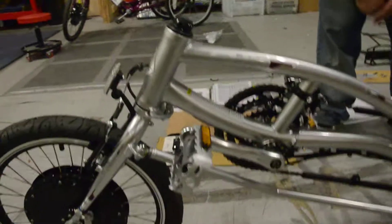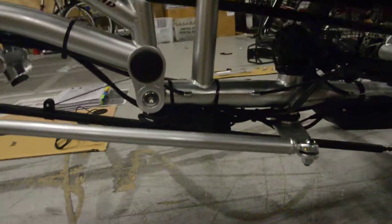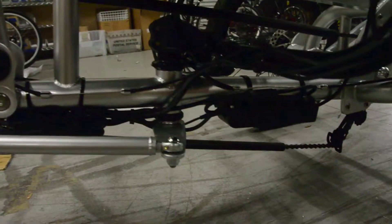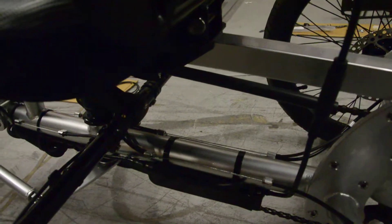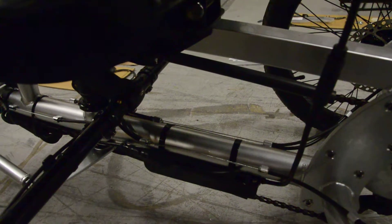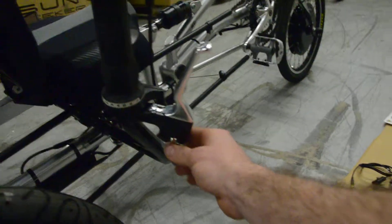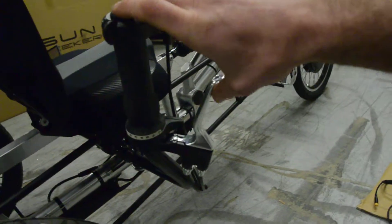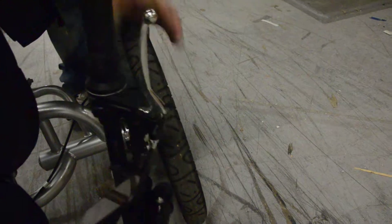When we run the wiring, it's mostly tucked under the boom tube. We bundle up the extra wire and put it under the suspension linkage at the bottom of the frame, and mount the controller with zip ties. Because you have this extra large tube back here, you have to zip tie it on — the clamps aren't big enough. Zip tie the controller down where the cables split and run the power wire up. When you're mounting the throttle and the e-brakes, note that this bike has two rear brakes and uses a BMX-style brake splitter. We don't have an e-brake that can pull two cables at once, so use the regular brake that comes with the bike and only mount your locking e-brake on the left hand for the front wheel's brake.